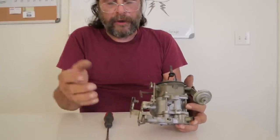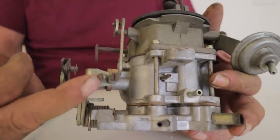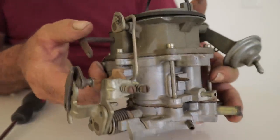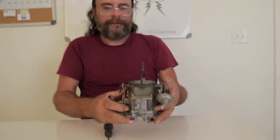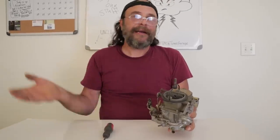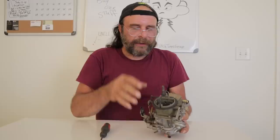Continuing on the outside, there's a second screw on this carburetor — all carburetors have a high idle screw. On this one, it's located next to the idle stop screw and is attached to the choke. So let's talk about the choke. Choke systems sent more carbureted cars to the junkyard back in the day than anything else, because when they fail it just wrecks the way the car runs — it fouls plugs, it won't start right, it'll chug.